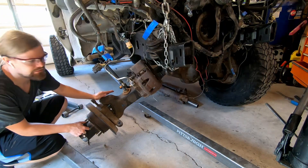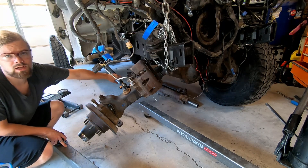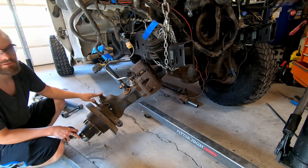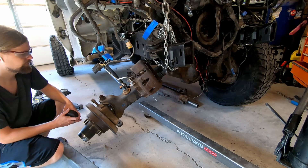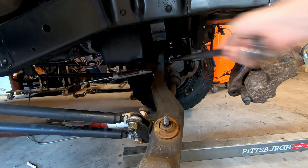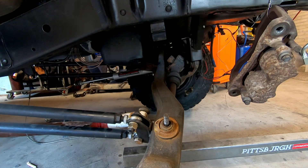So I found the limit. This is how far it'll droop before it starts binding — that's my max droop with these radius arms I built. The arms still have some movement in the joint, so I'm pretty sure it's not the radius arms binding. I think it's actually the axle shaft. So that's the limit of my droop, limited by the inner axles. It's actually that U-joint running into itself right there — it doesn't have enough travel. But good news: there's absolutely no binding anywhere in my suspension until I get to the limits of that U-joint.